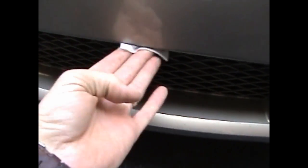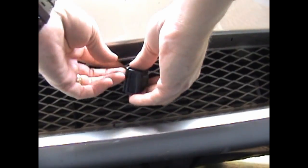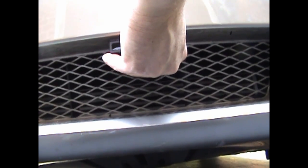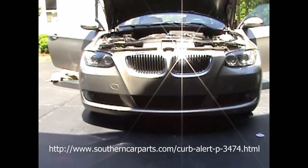We put the floor panels back in — it's all buttoned up nice and neat, you can't even tell we were in there. Same thing on the other side. Next, we're going to position and mount the sensor. Take an alcohol wipe and wipe the mounting area to clean it off for good adhesion. Take the sensor, center it, remove the double tape, center it right up under the car, push it into place and angle it to an approximate angle where a curb would be. You can barely see it on the car — it blends in well and is pretty well hidden.